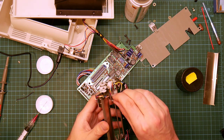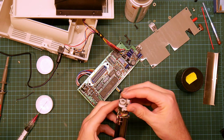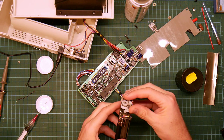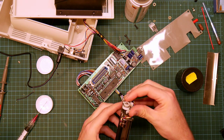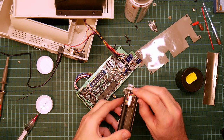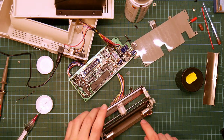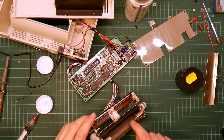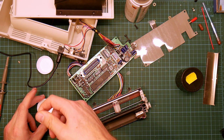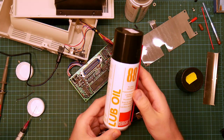When I move this, it is a bit grating, to be honest. And I can see a dark patch. The grating actually corresponds to one rotation of the motor bearing. So possibly the motor itself needs lubricating. You see there are these brass bearings fore and aft of the motor. So let's clean this off, get rid of the rest of the lubricant, put that aside, and get out the other one — lube oil. It is a light lubricant used for lubricating light things.